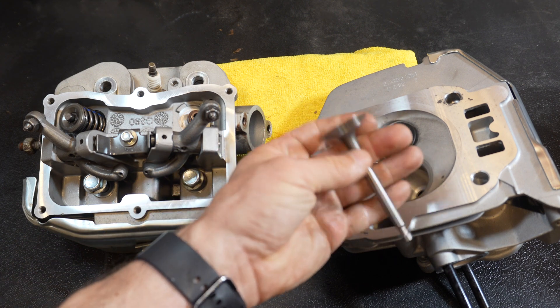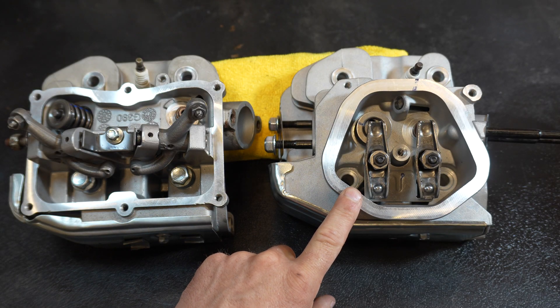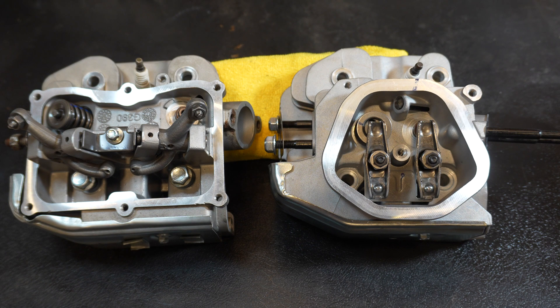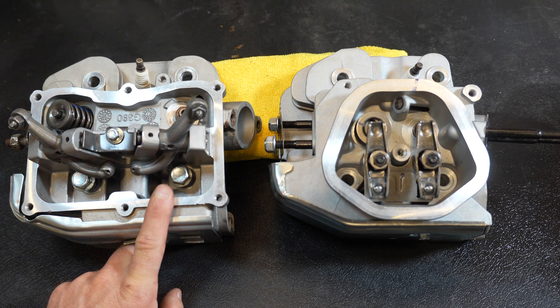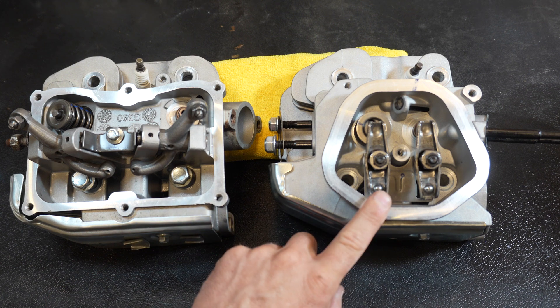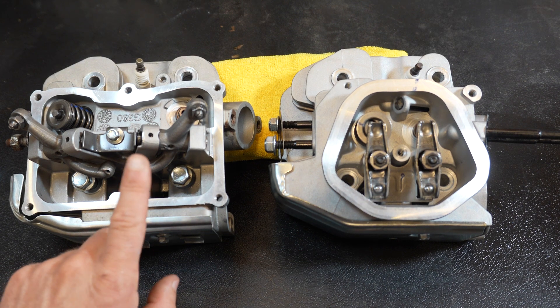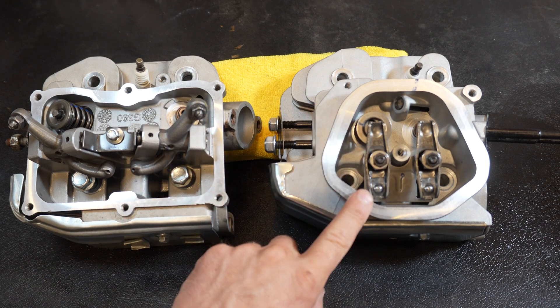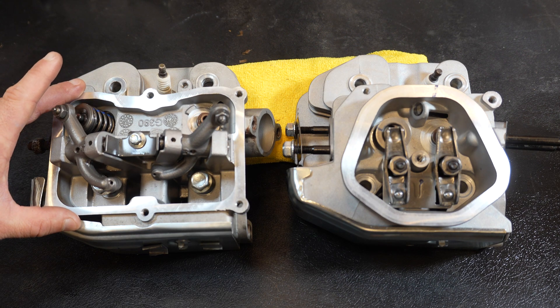They do sell upgrade kits for these — a full valve package that comes with a stainless valve with a split-style keeper to retain your springs. The unfortunate part is that whole upgrade kit costs about $262. If one of those spring retainer clips pops out on a GX390 or non-hemi Predator 420, that clip is what's holding your valve in place. If it releases, the valve is going to come out and bounce against the piston — it could snap off and you could be looking at significant damage: your head, both valves, your spark plug, your piston, potentially your cylinder walls, and anything in your drivetrain. Something both head styles share that needs upgrading for higher horsepower applications is an upgraded push rod. Historically the part number for these hemis is 60349.